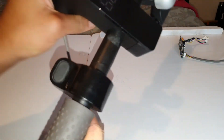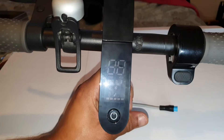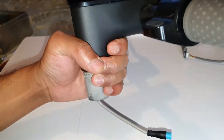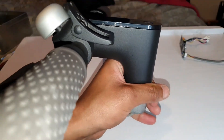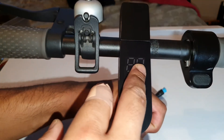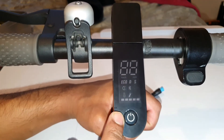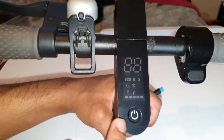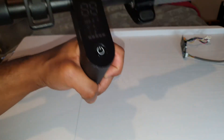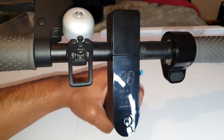And there you have the new display attached on. As you can see it's fully mounted on and there are no gaps - it's quite neat and you can see the display outline here. What we need to do now is reverse the order: put the power cable back in and then put the four screws back on. Once I've done that I'll show you what the next stage is.